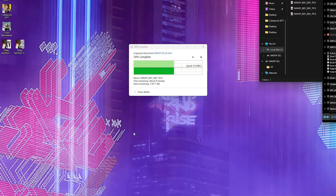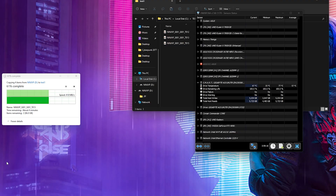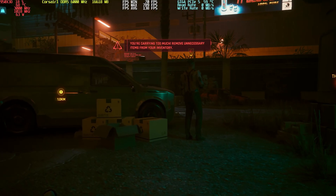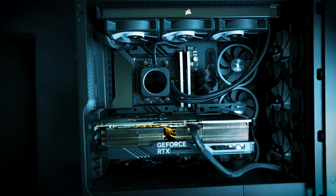For real-life usage, I did a file transfer via USB 3.1 to the disk drive, because those are more realistic numbers — especially if you use it for media and constantly transfer things. Transferring about 220 gigabytes, I got an average temperature of 68 to 73 degrees Celsius with the stock cooler. Gaming-wise, Call of Duty reached an average temperature of 59 degrees Celsius. Bigger games such as Cyberpunk 2077 in overdrive mode were also tested. Now we're going to remove that cooler and replace it with Gigabyte's cooler that came with the kit, to see if it cools better than the stock X670E Hero cooler.